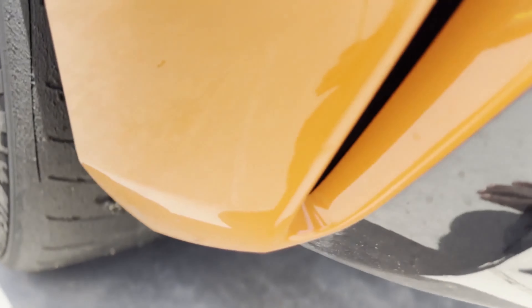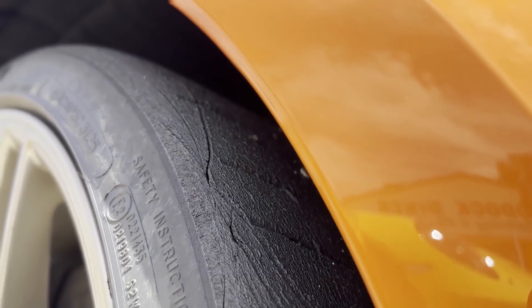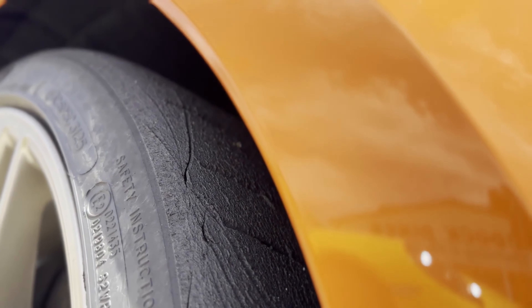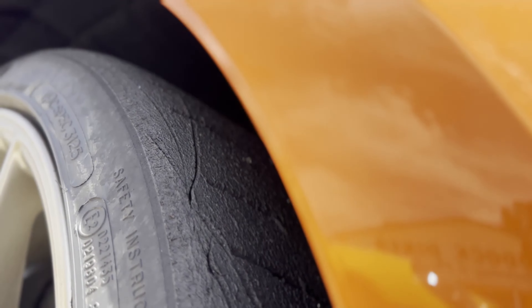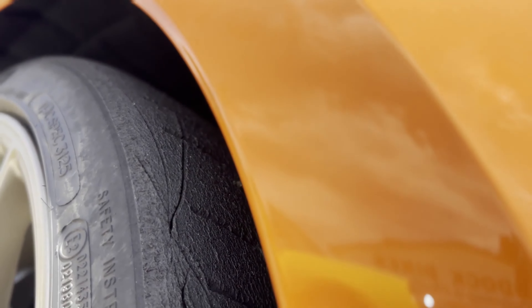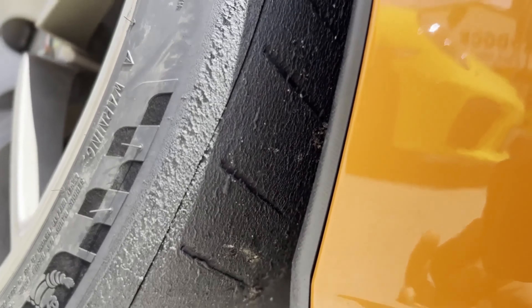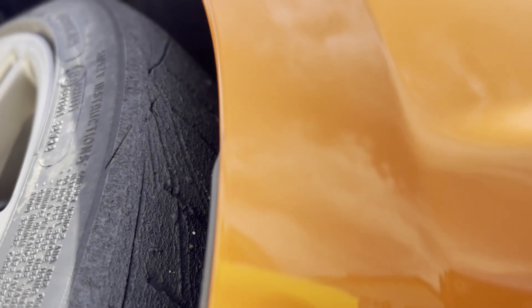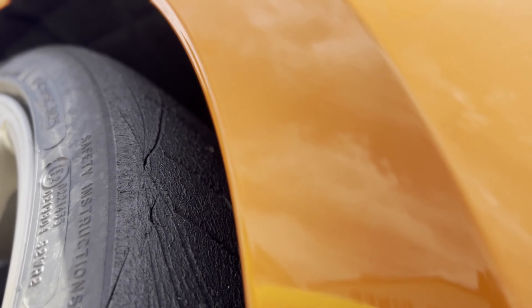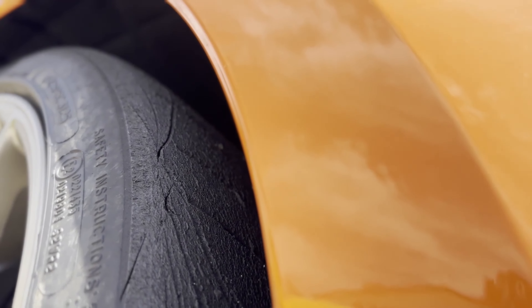I have something very funky going on with my tires right now. The Michelin Cup 2R tire is doing this weird thing and I don't know why. I'm only three sessions in, like 12 laps max. They're doing this weird spider cracking thing like somebody cut into them. I didn't run over anything. And even if I did, what caused the other one? Because this one isn't connected to those — it's like its own little one. It's kind of weird. I don't know if I want to risk doing another session on this, because if it starts coming apart in the middle of turn eight when I'm going 140 into there, that's not good. I might be done for today.